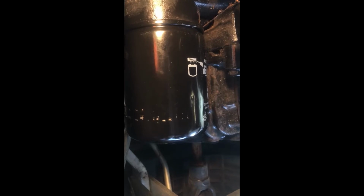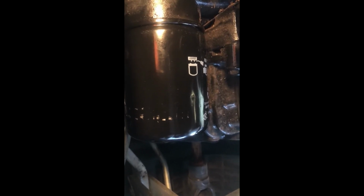So there's the new hydraulic fluid filter installed. Next, we'll do the screen and the magnet. All right, so now this is actually the last piece of the maintenance. What we're going to do is take this rubber hose and move it up. Looks like they put this one behind, which is a bastard. So we're going to move these clamps first. We're going to get these clamps off so we can pull this hose off.